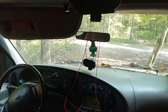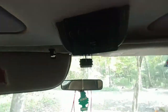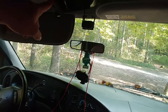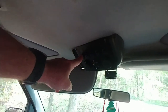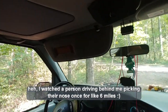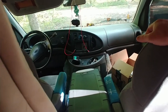Up at the front I've got this five-gang switch. Everything from the main cabinet back runs on the house battery, but this one runs on the start battery — and the reason is it only has two things on it. When I was driving, my leg kept hitting the power seat switch and the seat would move on me, so I put it on a flip switch: once the seat's adjusted I just shut it off. The first button is for the power seat main power; the second is for my backup camera, because sometimes I still want to turn the backup camera on while driving. It also gives me extra outlets, extra USBs, and that sort of thing.